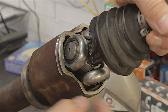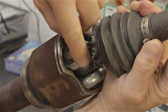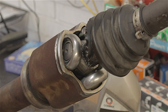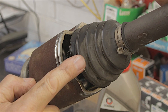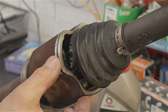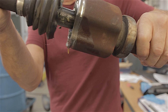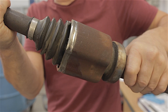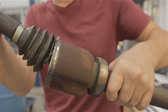As with these things they're always a little bit fiddly - you've got to kind of align the bearings in the slots in the cup. There you go, and we're in - that's a nice sliding fit in there. We push that all the way in. Obviously you'd put your boot on. I would suggest these hard rubber boots - do not ever use a cable tie as it will never hold them. You want to get a proper metal strap, preferably the one Ford supplies. And there you go - that is absolutely perfect. I'm twisting the drive shaft halves against each other and there's next to nothing in the way of play. It doesn't feel like there's any sloppiness, so that's good.